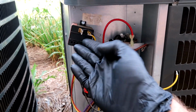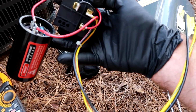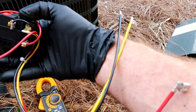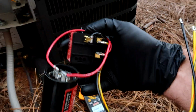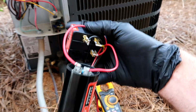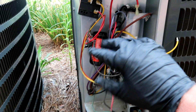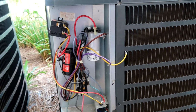A lot of guys are saying just replace this and this, and as you can see, it all comes together. It's already hooked up and wired and everything. So you just got to hook up the wires to the capacitor and the contactor. That's how it comes in the package. I'll leave a link to these in the description below. Real easy. So we're going to replace this and the capacitor, and that should fix it.